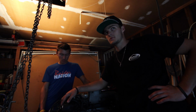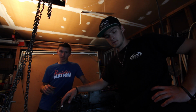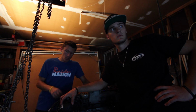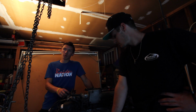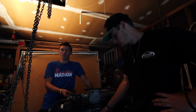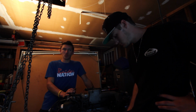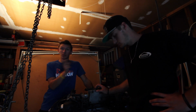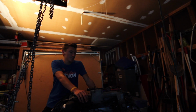Well, we could probably drive around the neighborhood, but he's gonna have to get it tuned for the upgraded turbo. If the tuner's there, I probably could move it. But the only thing holding us back for now is this upcoming week, I'm going to pull the water pump off again and make almost all those holes new with Heli coils, because one was stripping and it's got plenty of room, so the bolt's not bottoming out. I think it just must have not been drilled correctly.